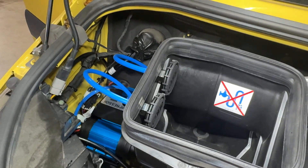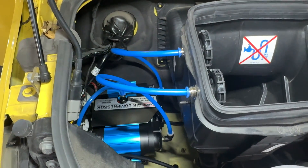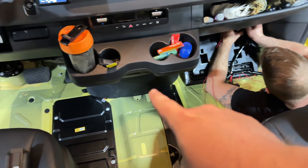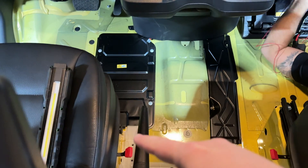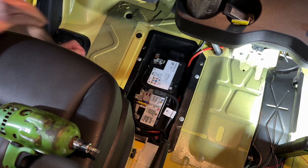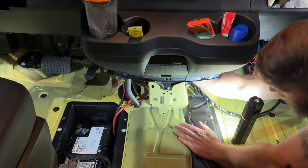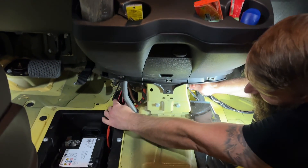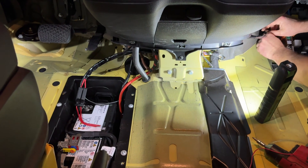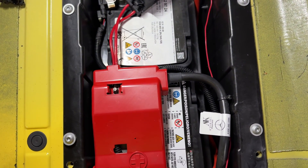The pressure control module is the thing that is going to allow me to control the air pressure without having to open the hood - I love that concept. The trigger wire is going to come across the van and down through the battery compartment and hook up to the S-pod controller under the driver's seat. Doing that will allow me to turn on the compressor from the driver's seat or outside of the van from my phone via Bluetooth through the S-pod. And then I can control the air pressure through the pressure controller with the air compressor kit - it's kind of a neat setup all in.